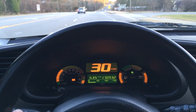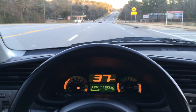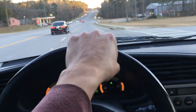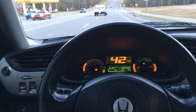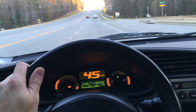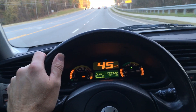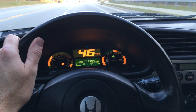Honda Insight Generation 1 — this is a review and discussion of my clutch switch mod, which I'm going to demonstrate here. The clutch switch is one of the most common modifications people do to Generation 1 Insights. Basically, there is a switch that, when you push the clutch in, it turns off the IMA battery's ability to charge or assist the car, giving you control of when the car is charging and assisting.